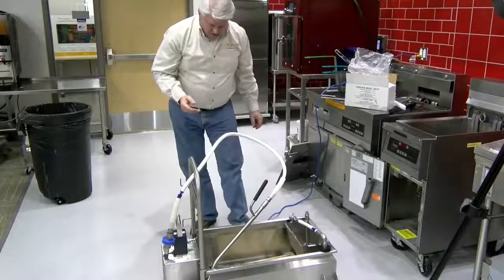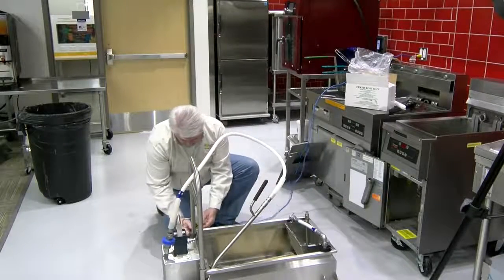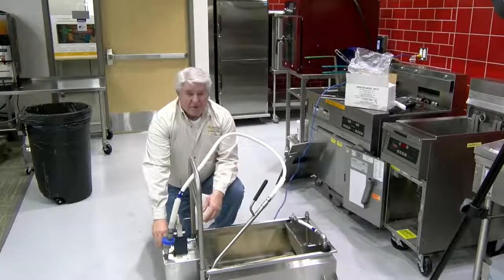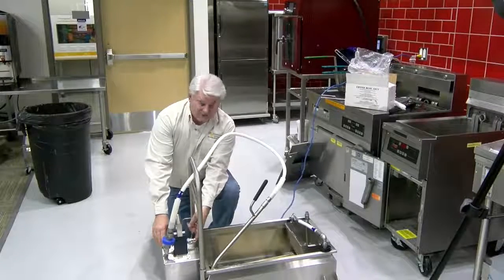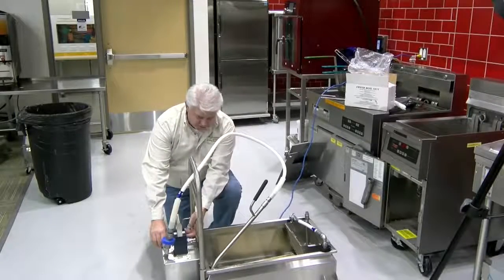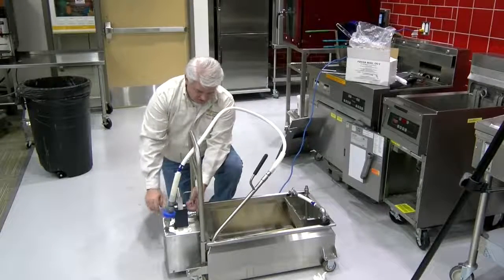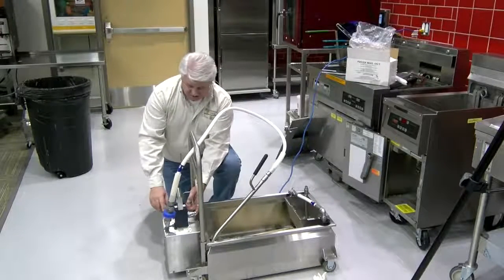I would like us to go ahead and plug the machine in. We will turn the motor on, and we're going to put our finger over the intake. What we want to feel is that there's suction, that the pump is turning, and that suction is working, and is enough to pull oil through the pipe. You should be able to feel and hear a difference.